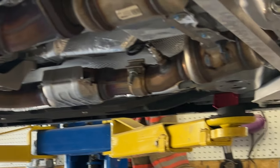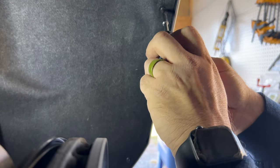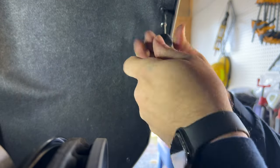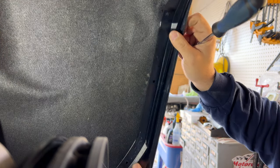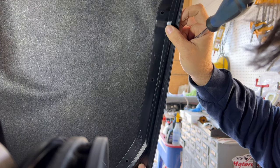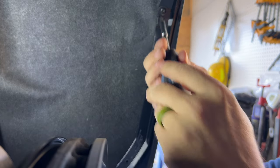Those hockey pucks really come in handy - they're only 12 bucks for a dozen of them, and I keep a dozen in the shop. For the rear, we're gonna remove these three screws going into the inner fender liners. Here's the rear rock guard - we just fit that in place. They are molded with the body line, fit very nicely, and then just replace your screws and snug them down. The rear is done - that's how easy that is.